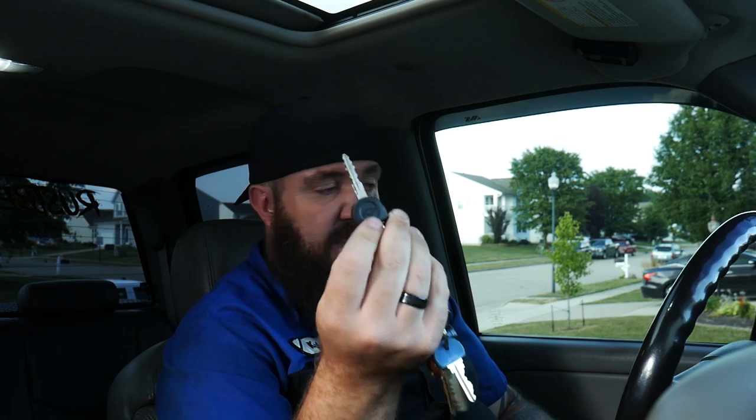All right, so now we're gonna go through showing you guys the pairing procedure for your key fob. So really easy procedure, just make sure you pay attention to this one. All you're gonna have to do is close your door, make sure all your doors are closed, everything's off. You've got your ignition key here in your hand. So with your other hand, you're gonna hold the unlock button on the door, holding that one, and then you're gonna cycle the ignition key on, off, on, off. You heard the horn honk and the lock cycle.